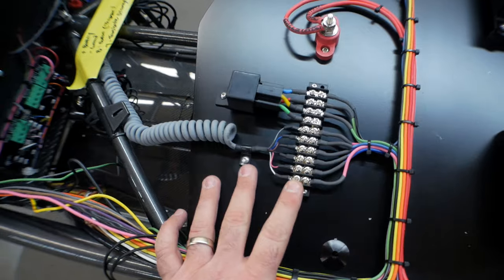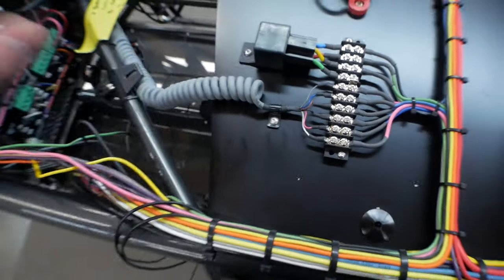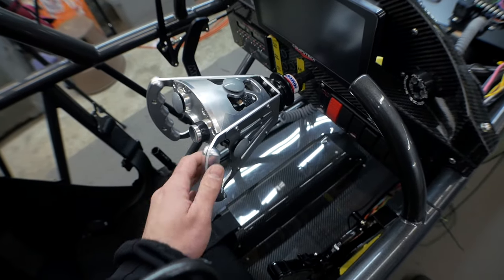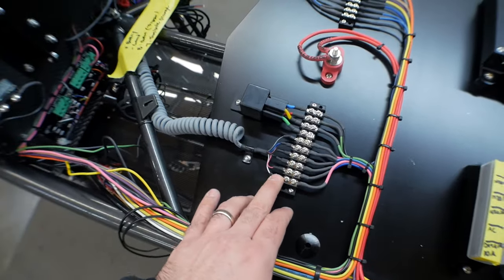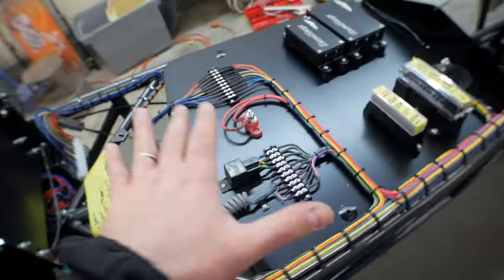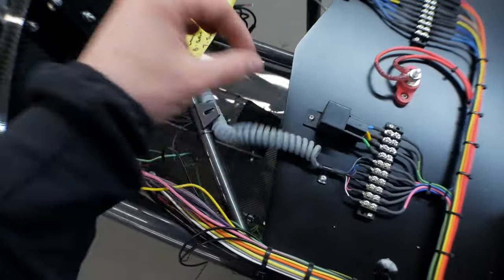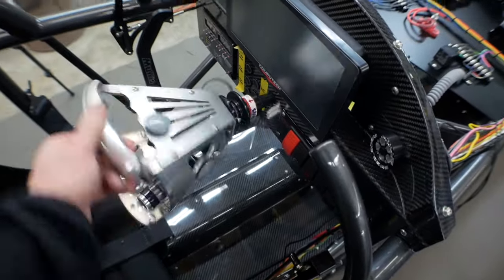Here in the car, you can see that we have accomplished the goal of just one singular cable coming out of the steering wheel and going back behind the dash. It kind of comes up to a terminal here, and it's a six-conductor cable coming out of that steering wheel. There are obviously five buttons on the steering wheel, so each one of those buttons needs a wire returning from it. What we ended up doing is bringing our 12 volts onto the steering wheel as a common — one 12-volt coming onto the steering wheel, and then it gets split up inside and goes to each button. So each button will then complete the circuit and send a signal down. We ended up with a single curly cable — lightweight, thin. This thing's like a wet noodle, you guys. It curls up on the steering column just how you'd like it to.